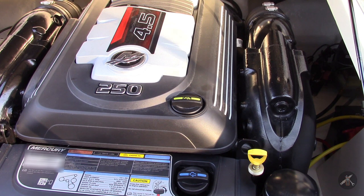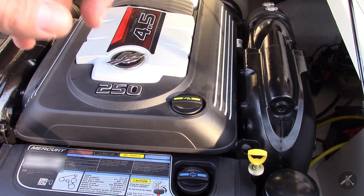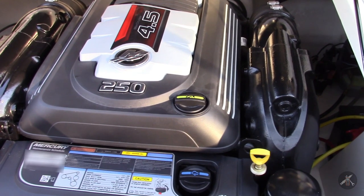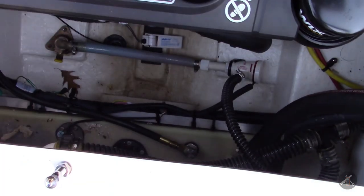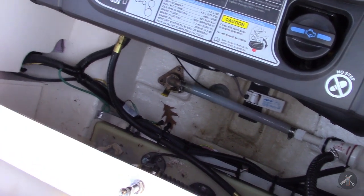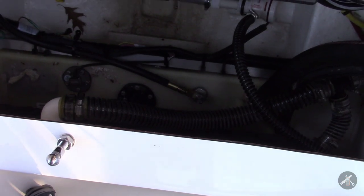The next thing I do is fire it up. There's water connected — the garden hose is connected at the back so the engine has water. I'm going to light it up and idle for a minute and make sure that it runs before I connect the fuel and connect in the other lines. The fuel tank has a fitting right there, a fuel hose that goes up to the inlet, and on this tank that's where the flare fitting is that I need to connect.